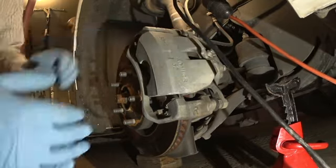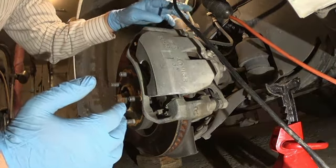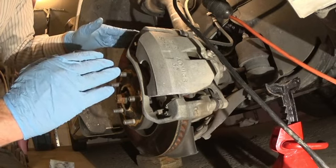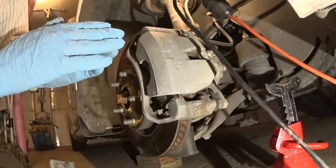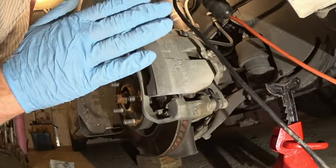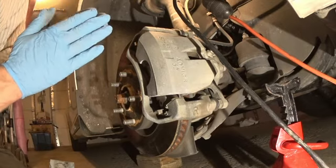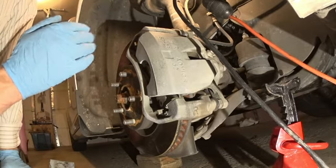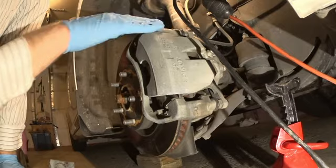You can see the brake caliper is not sliding because the pins are seized — they should be lubricated. If they're not lubricated, your brake pads will wear out much faster and your rotors will overheat much faster. When you release the brake pedal, the brake pads are supposed to separate and push back. But if they're seized, there's nowhere to go, and it keeps grinding the brake pads against the rotor surface even when you're not applying the brakes. That's why most brakes will squeal — because the pins are not lubricated.